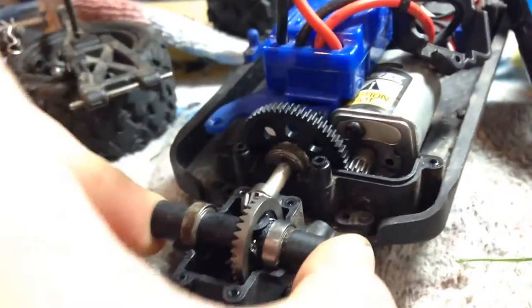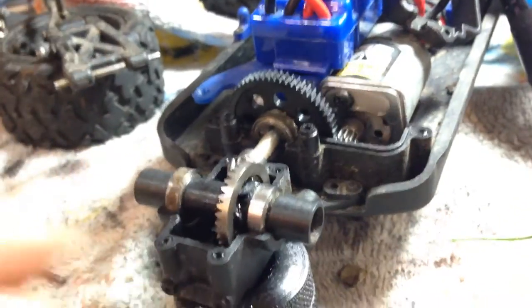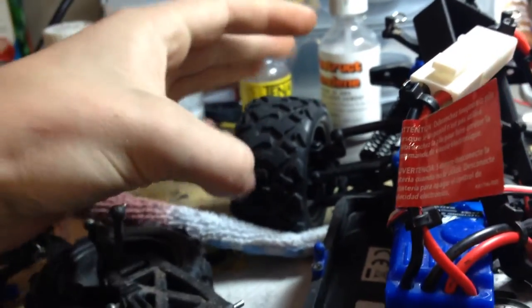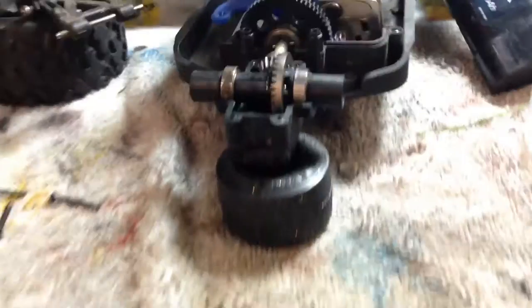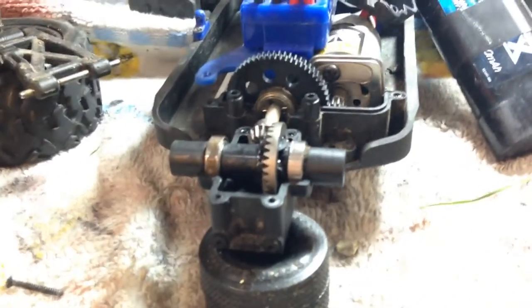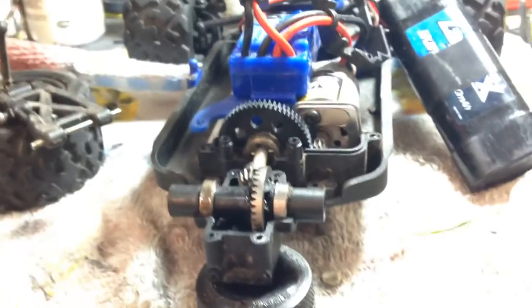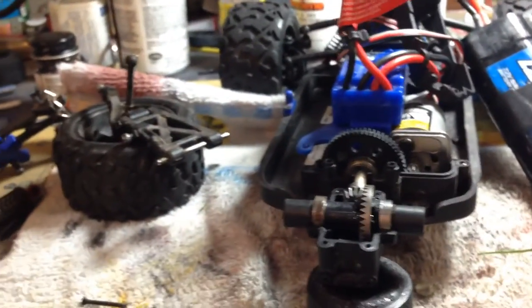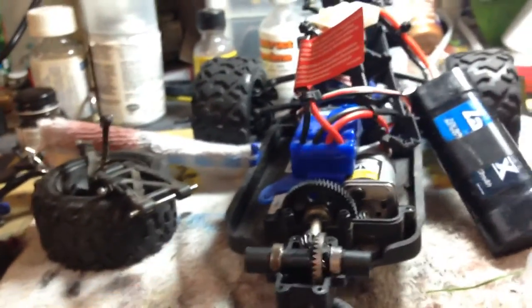Once you do that it should be locked — both wheels are going to spin at the exact same rate, and then you won't get stuck. Say you're in snow — snow is the worst. If this wheel gets caught on something, normally it's going to spin to the wheel with the least amount of traction. But doing this, which is basically positive traction, both wheels spin at the same time, going to both the wheel with the least and most traction. Basically you're probably not going to get stuck.